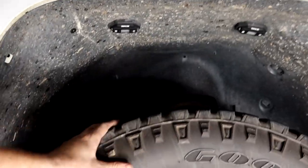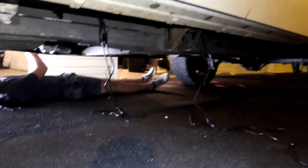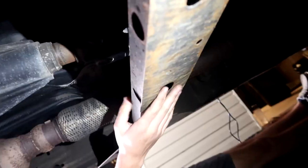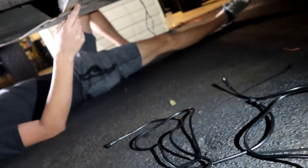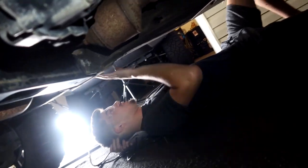All the other lights are now mounted — two inside this front fender well and two on the other front fender well as well. All lights are mounted and wires are routed underneath. Looking underneath: on one side the wires run neatly along the existing wiring loom. We're planning to mount the control box somewhere in the center frame rail where all cables converge. Drake is finishing the last bit of wiring on one side while I work on running the power wire.